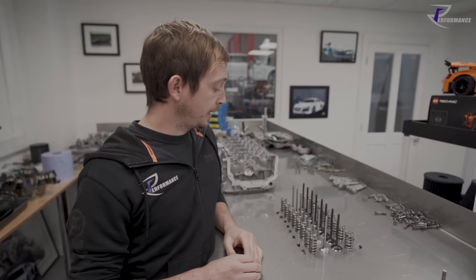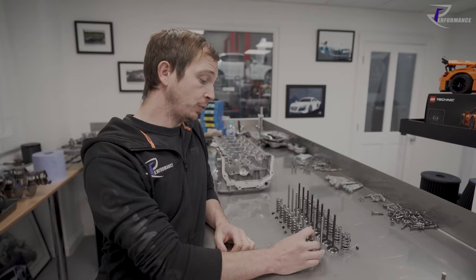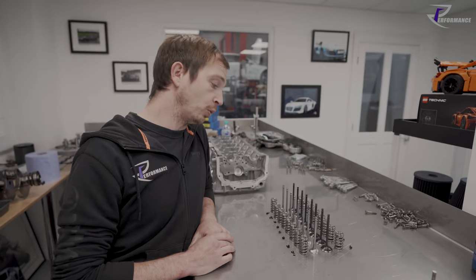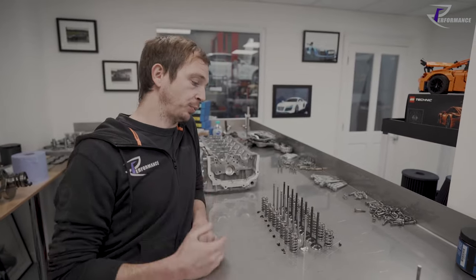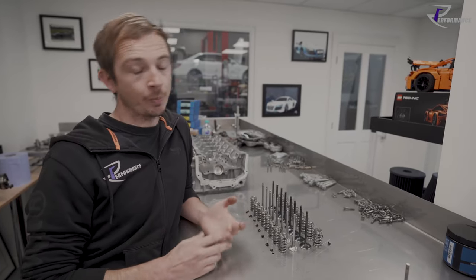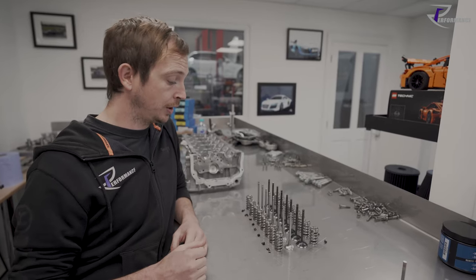So, yeah, it's taken us a little while to do the math, to figure it all out. We deal with good manufacturers who help. We tell them what we want to do, the numbers. We tell them the boost pressure, the crankcase pressure, the exhaust manifold pressure, the compression ratio, that sort of thing. And they'll come back and go, "Well, we think you need to be at this sort of pressure level, spring pressure."